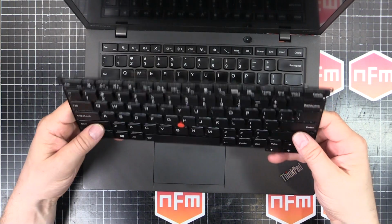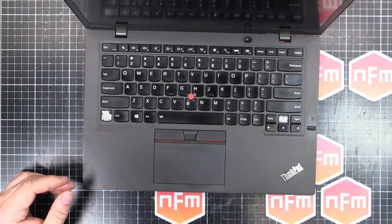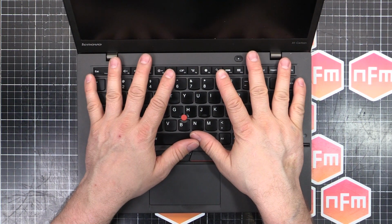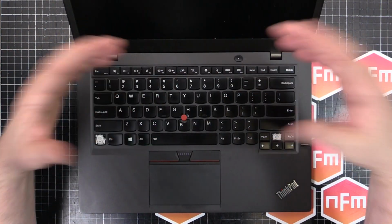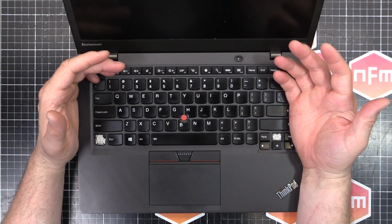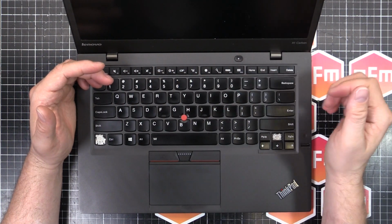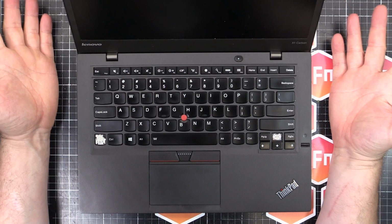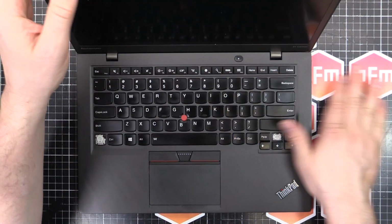That will go straight in, and this should be relatively easy, except for the fact that you can't access the keyboard from the top. A lot of laptops, including my Dell Precision, you can just take out a bezel and then a few screws and the keyboard comes out. You do that in the Precision series generally to access the top RAM slots. There's 4 RAM slots in the Precision, so 2 on the top, 2 on the bottom, and it's a simple thing to take it out, but in this laptop it looks like that's not the case. You can't take it out the top at all.